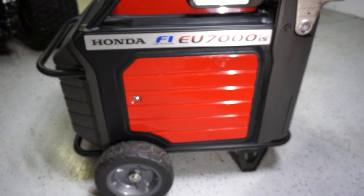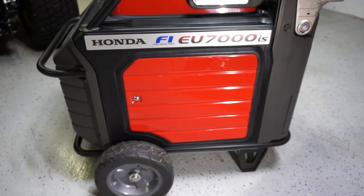I recommend doing it at least every two years. I've had a couple of plugs go bad over the years, and on a generator it's well worth the three bucks to replace it before it becomes a problem. If your generator is brand new you don't need to do it, but it's important to know how because you might need to at some point.